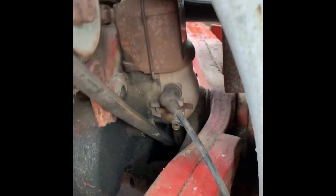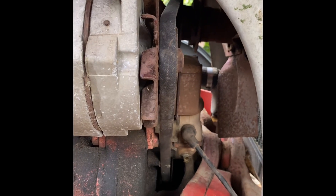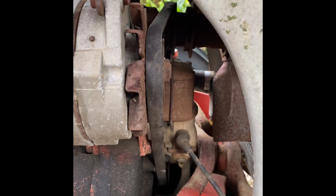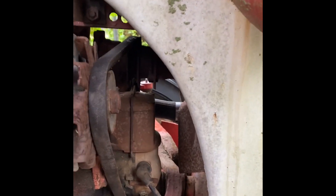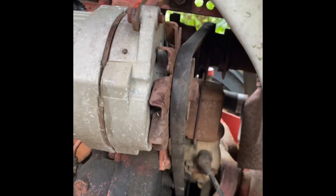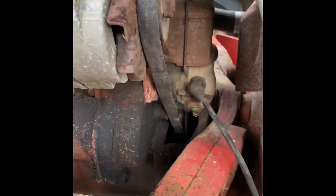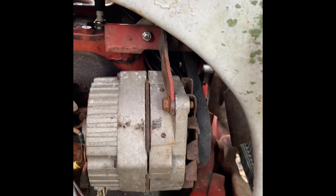About to take her off and get the rebuild done. I did notice that the alternator bracket placement has it set back about a half inch and it looks like it's at the wrong angle too — looks like it's trying to rub on the bolts. Going to go ahead and take that off and fix it at the same time. Got the points all rebuilt, new cap back on, plug wires made up and zip-tied out of the way. Straightened the alternator out — might have to come back and adjust it a little more.